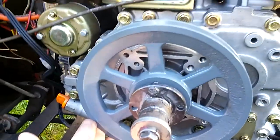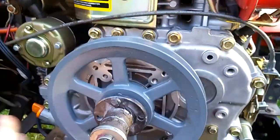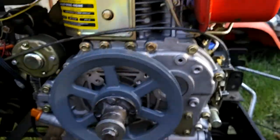This is what the setup is going to be. By running this I did some checks — I'm actually clearing the middle cross member a little bit better at the steering rack, so it should work out a lot better with this pulley. Lots of anti-seize on it — obviously I do not want this to get seized to my engine. It's nice and tight right now.